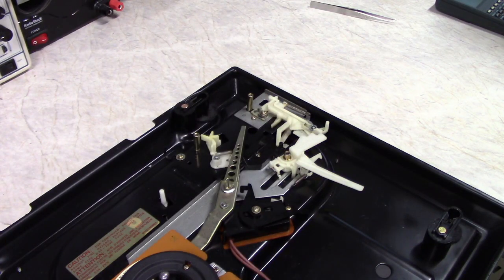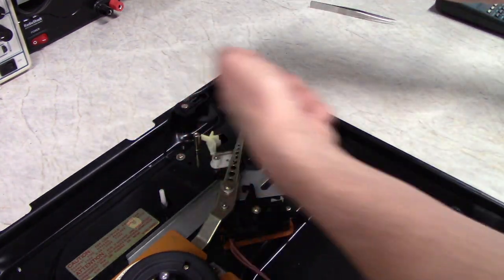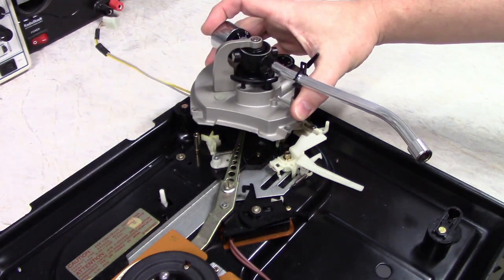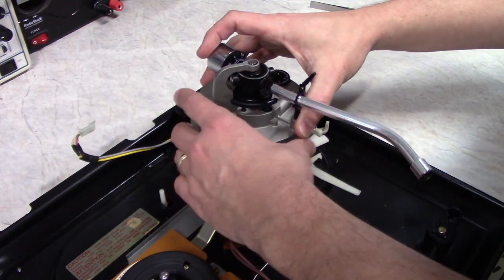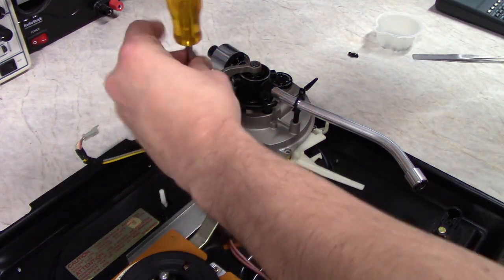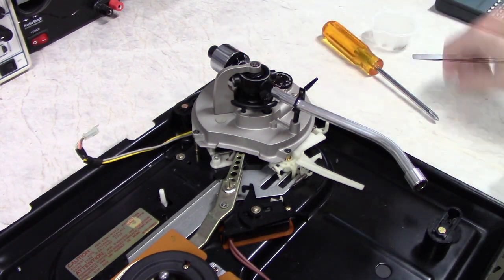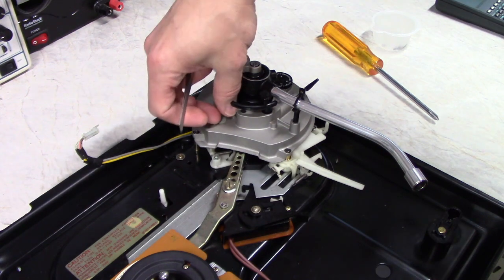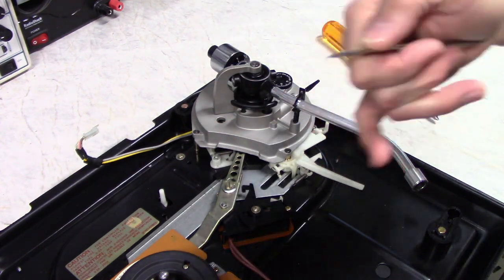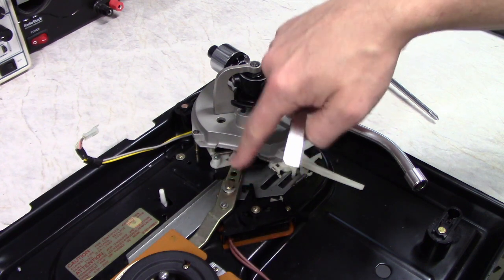Time to put the tone arm back on the frame. There's a pin right here and this lever — they just need to be on this side of this plastic, in the parked position. You just set it straight down and everything should line up perfectly. Three black machine screws hold this down. Put the rubber plug back in. There are two other adjustments — one is under this plug for the start position, where the needle will be dropped for various record sizes. Then this adjustment here, accessible through a hole in the black plate, is for the stop position — it's a very, very touchy adjustment.